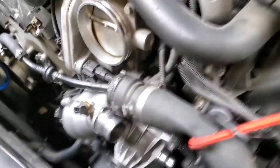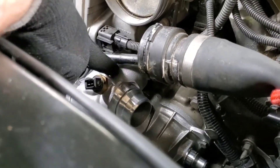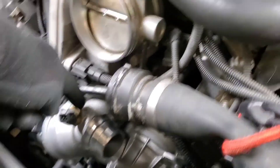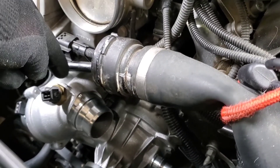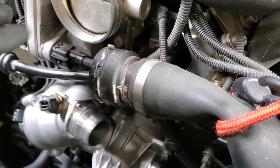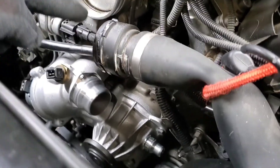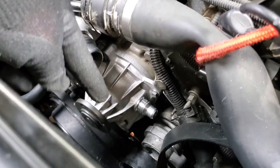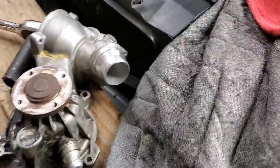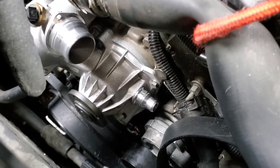The new water pump is in and it wasn't too hard. The only thing I'd say is just be sure and lubricate that new connecting hose. And then on your new water pump, there's a second smaller pipe. There's an O-ring inside the actual water pump housing. You've got to lubricate that a little bit and make sure that this whole thing is going to slide together, and make sure that this big pipe when it's replaced has to be completely seated into the engine before you can try putting the water pump on it, because it all fits real tight. But once you've got all that worked out, I can reach all the bolts relatively easily. I kept the old one up here so I could find exactly where they were without having to use a mirror. And now I'm going to try to remount the crank pulley. See how that goes.